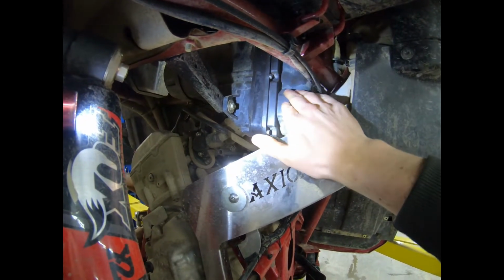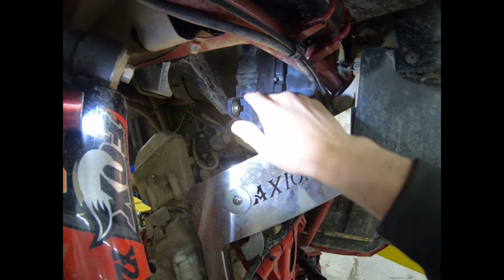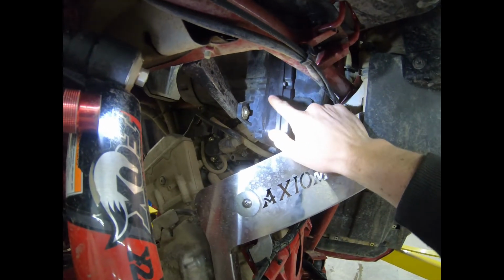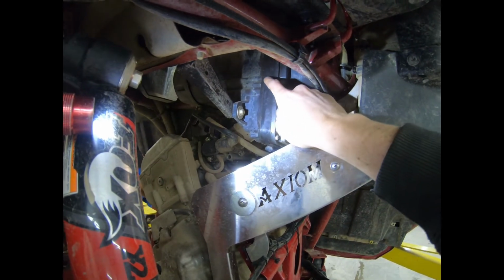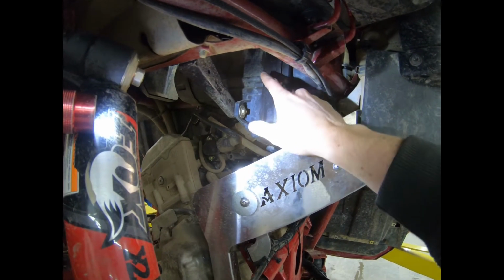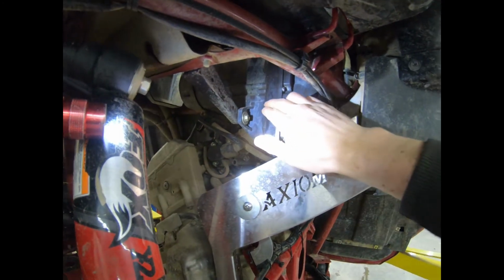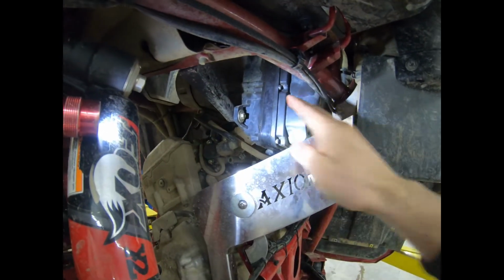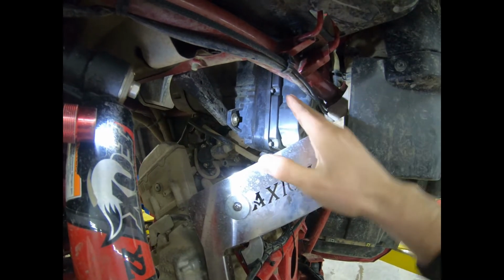once you get the hat off, clean it out, then you're going to go ahead and feed this spacer, which is going to have 2 O-rings that go around the spacer. You can use grease or dielectric grease. It's a little stickier, and you're going to go ahead and apply a little bit of grease in there to hold that gasket in place, or that O-ring. My recommendation is getting this piece fed up, get the spacer fed up, and then while the spacer's kind of just rolling around in here, you're going to take the hat and you're going to feed it up.